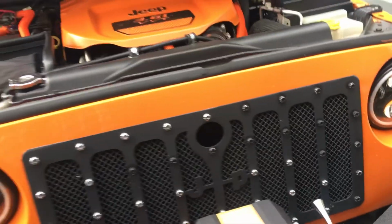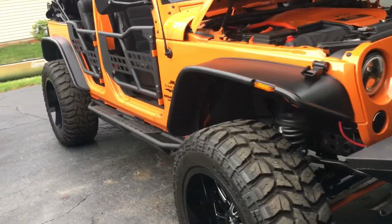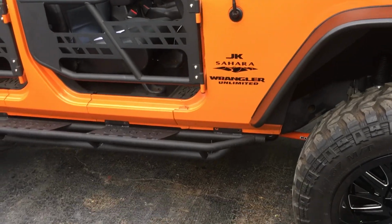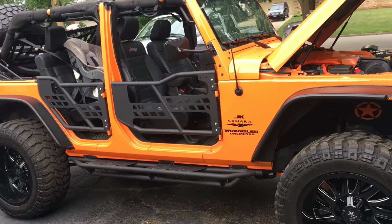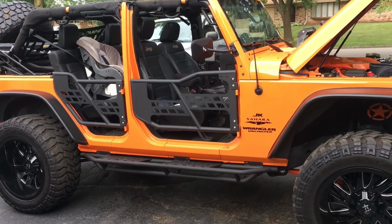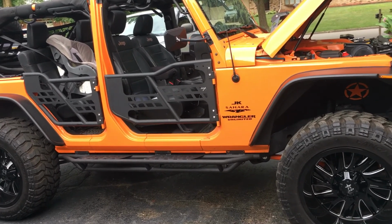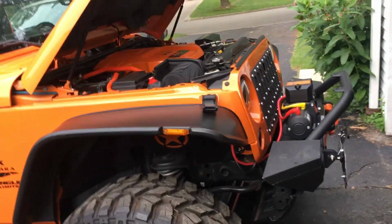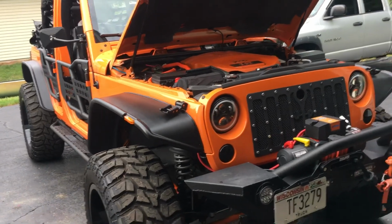And every third oil change, I change the transfer case fluid and the rear and front differential fluid. Extremely easy, easier than changing the oil. I'm not sure of your mechanical level, so just disregard anything that I may say that's too simple for you. But yeah, I usually just change those every third oil change, so I would look at probably changing those. Other than that, maintenance wise, I can't think of anything you will need to do for it.